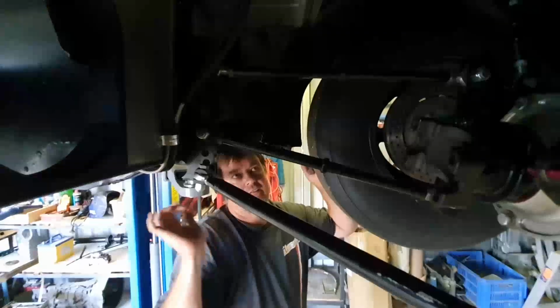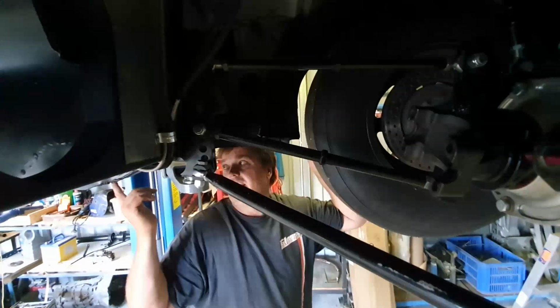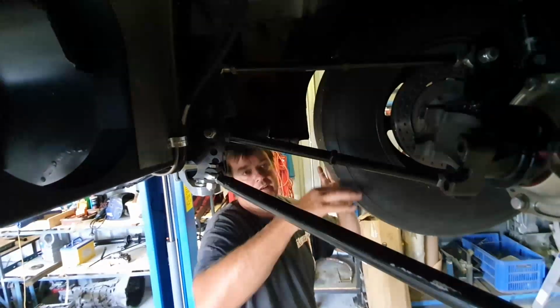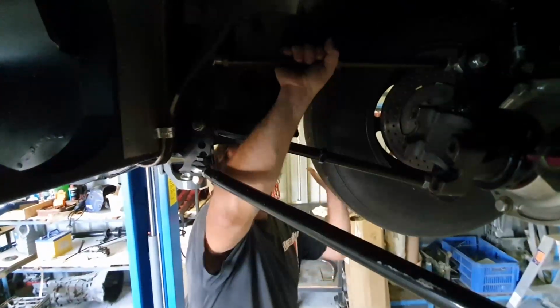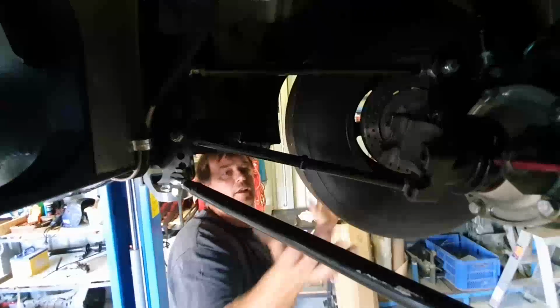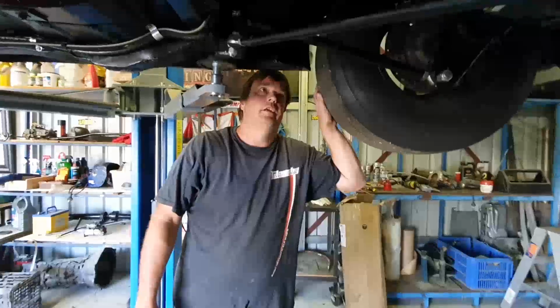So right hand hook, we've got right hand steer here, so we're getting a little bit too much drive on this tyre. So we wanted to transfer a bit over to that side, so you put a flat into that, which lifts this tyre ever so slightly. If the car's turning left, you give it a flat the other way, vice versa. It helps the car track off straighter down the track.